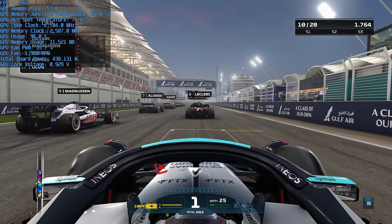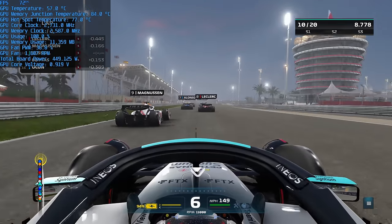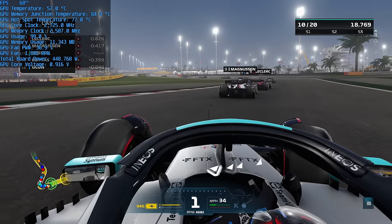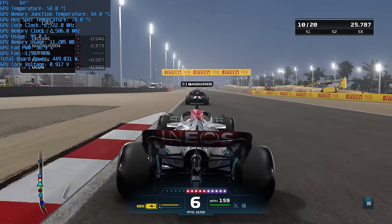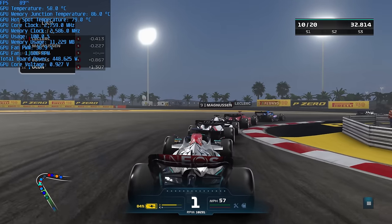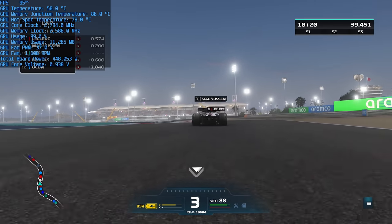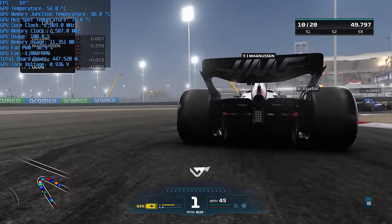This resulted in a 4-degree increase, up to 58 degrees on the GPU temperature, while memory junction increased to around 86 degrees — both still cooler than the other 7900 XTX cards at stock. The hotspot increased but remained under control at 79 degrees — still dramatically less than other cards. There were moments where the clock speed rose above 2800 MHz during extended gameplay at 100% GPU utilisation. Due to the increased power limits, total board power came out around 450 watts, while fans remained around 1600 RPM.